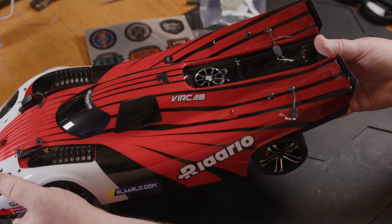So that gets us a look at the actual spur, which is metal. Although you've got the plastic hexes and the plastic spur gears, it does actually come with a metal spur gear. So what size are the pinions? Looks like we get two pinions, one that is a 3.175mm and one that's a 5mm shaft. That's what it looks like. Obviously 5mm shafts are for the bigger style motors, so it's a bigger actual gear. But yeah, that's how we get down to this little bit.